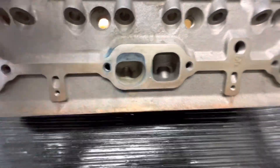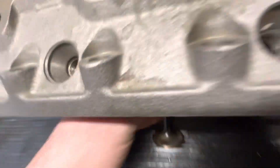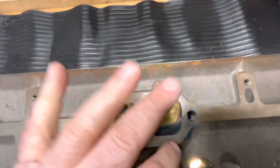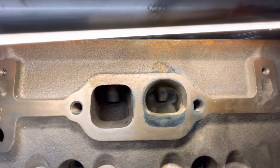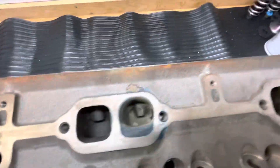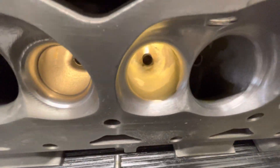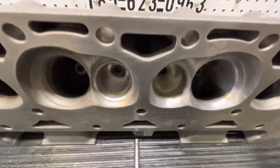You can see it's got epoxy on the floor. Let me turn it around so you can get a better look. You can see the floor — everything's filled with epoxy. When I get it, this will be brazed so the epoxy won't run. You can see how the exhaust port gets worked. This is probably 65 cc's. It's got some epoxy inside the bowl into the seat — all of that's there. It gets digitized with the epoxy in it, then the head that you're going to run, you don't have to do anything to but make it legal.